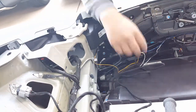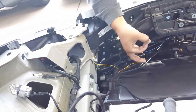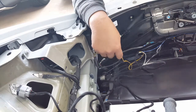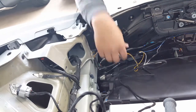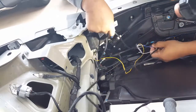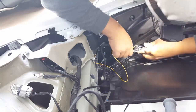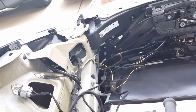These wires are really nice quality ones too — they look very thick. Going by gauge wires, the smaller the number the thicker it is. So a gauge one wire is really thick like this. A gauge ten might be a little thinner. These guys right here look like at least gauge 20 or 16 wires so they're still pretty thick — not like the typical 24 or higher. The higher the number the thinner they are. All right, so where we go — we're still on track, almost catching on to everything else. There's not a bunch of wires bundle — I think we could start bundling it somewhere maybe even here.